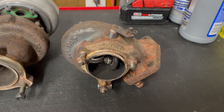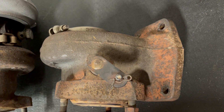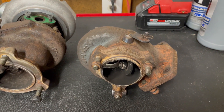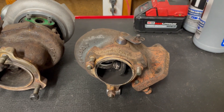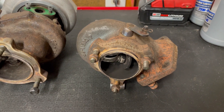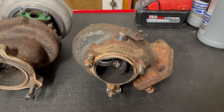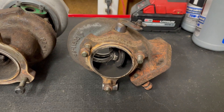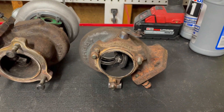The last one is the conical flange, and this is the smallest of the three. This one also comes out at a straight angle from the actual flange. That's good. And this is the easiest to install because it uses the exact same mounting shape and size as the stock turbos like the 13C. So if you've got a 740 turbo or 940 turbo that came with a 13C, this will bolt right up. There's more work to be done than just the turbine mounting, but you would not necessarily need a custom downpipe unless you just wanted one of a larger diameter. Because it is the smallest one, it doesn't flow as much — but if you're looking for ease of installation versus flow and maybe you're not looking to run crazy high boost, that's just something to keep in mind.